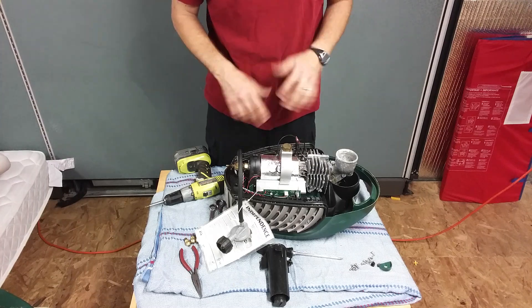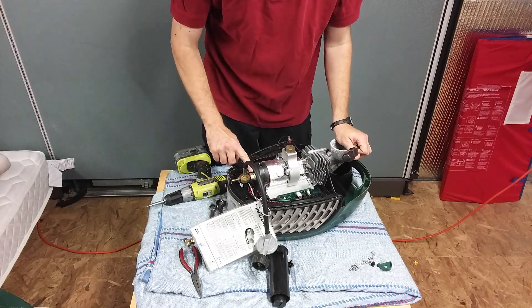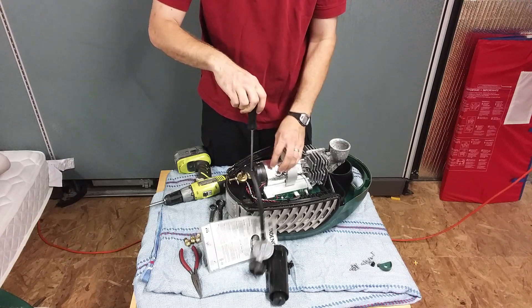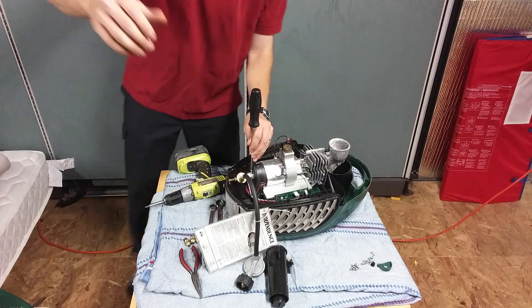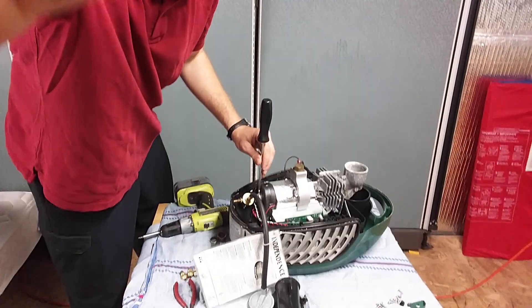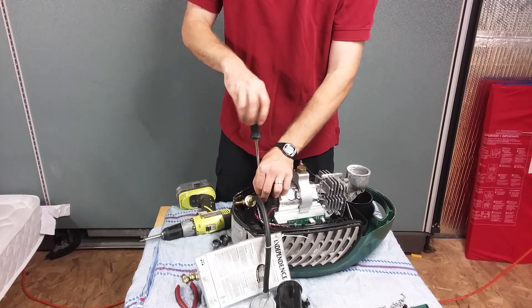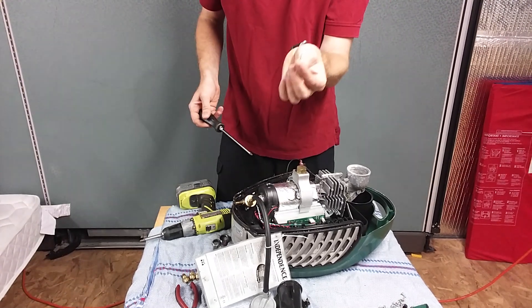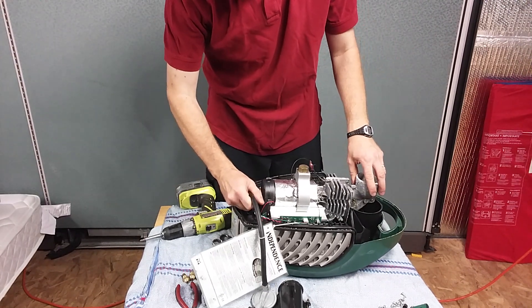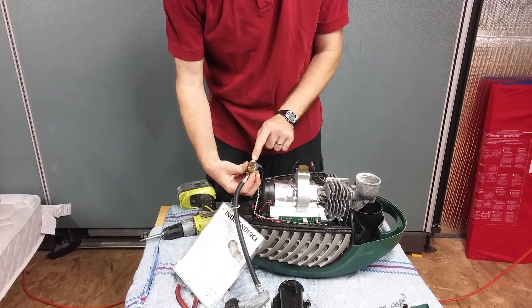The fuel nozzle is now right in here. There's one screw that you need — right here — that you need to loosen a little bit. You can't take it all the way out as it's a little hard to get back in. Keep track of that screw as it's different from the others. Then you carefully take this valve assembly out, and there's our old nozzle.